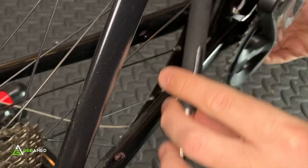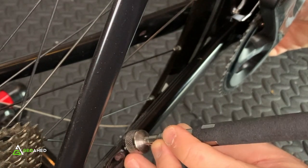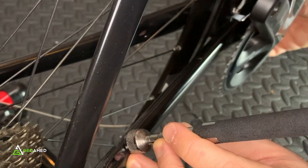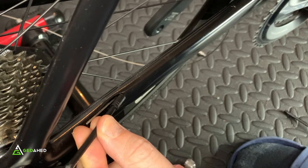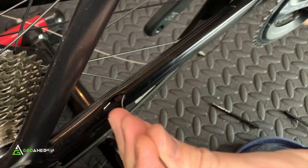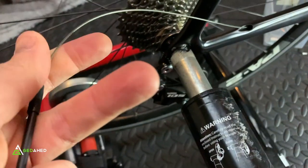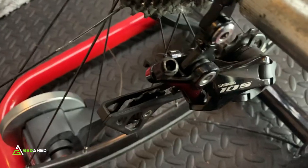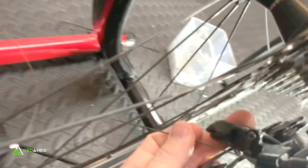Getting the cable higher up is easier without filming. There's a notch inside to watch out for — it takes the pressure when you put the cable end in. Once past that, the cable is located. After the cable is through, the cable head sits against the frame. Feed it through and into the rear derailleur — the cable bit from the pack feeds through that spot and into the rear derailleur.